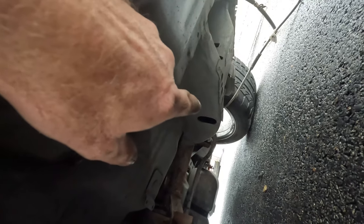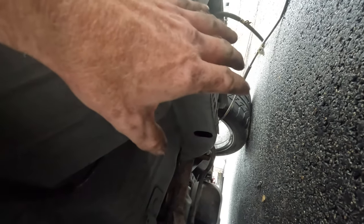So what I've done is I've just actually reinstalled the e-brake cables that were on this car, because they are the same, they're the right length, they're the right design, and they will work on our 8.8 setup. So now technically it looks like there's two sets of emergency brake cables per rear wheel, which is fine, because once we get the back jacked up, then I'll pop the drum off, and then I'll swap out the original one for the four cylinder ones. Of course, I'll get them mounted back up near the torque box floor pan area there. And now, time to get this drive shaft installed.